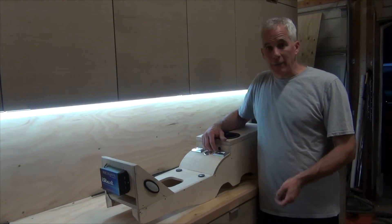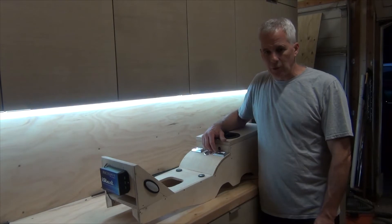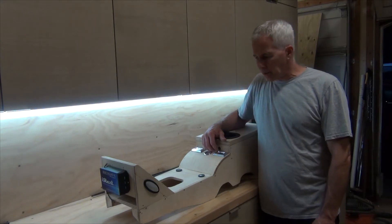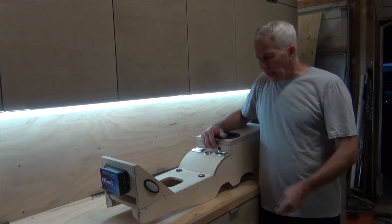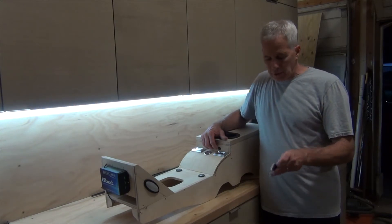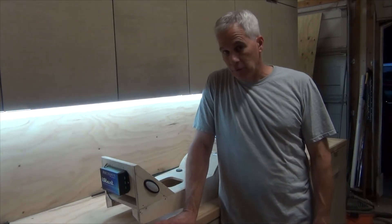I abandoned the brain that came with the door poppers and replaced it with a couple of relays — it's a 35-amp deal, which is a fairly significant load. There was no good way to control it with these little micro switches. So I'm connecting the door poppers to an accessory port on the Ron Francis I-Start, so the key fob I keep in my pocket to start the car will also give me door popper control. There are no door locks because there are no door handles.